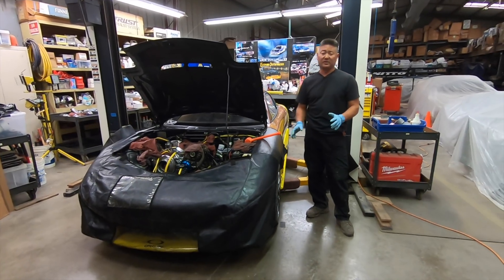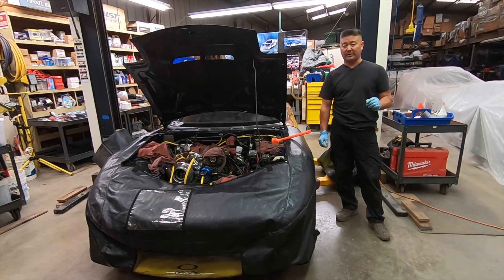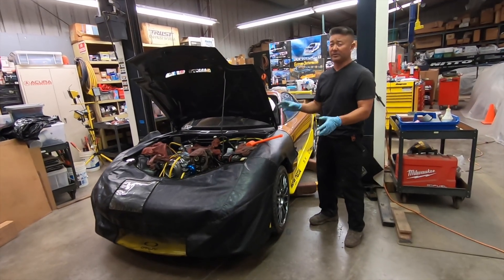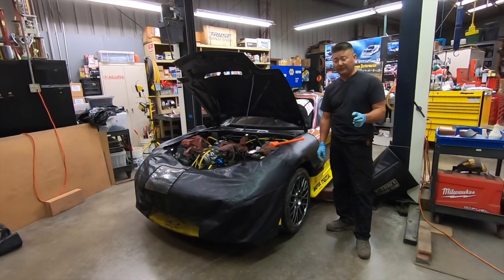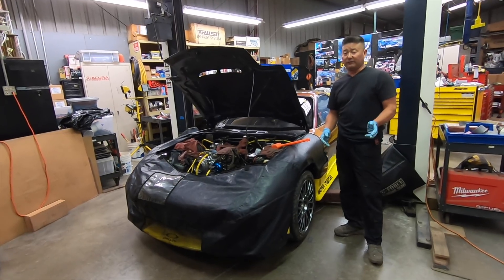Since the engine has been sitting for over 15 years, everything is dry. There may be a small film of oil on the bearings, but there's not going to be much in there. So the first thing I did was change the oil. It's very simple in this vehicle. Usually when we're racing I run Mobil One 15W-50, but because I want the oil to go through the system as fast as possible and get to the bearings, I loaded it with 5W-30.